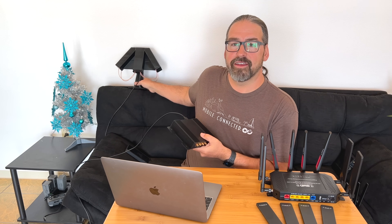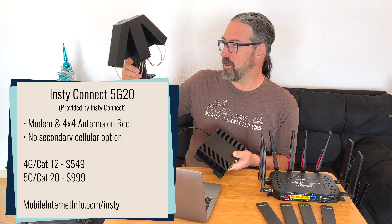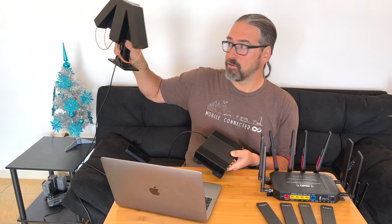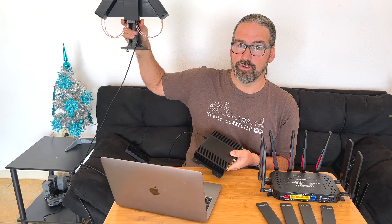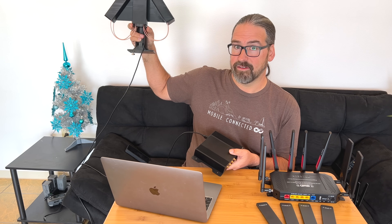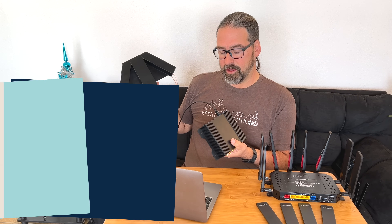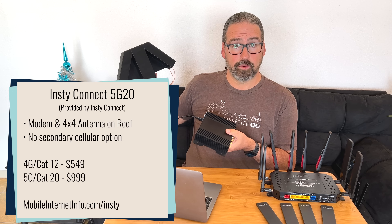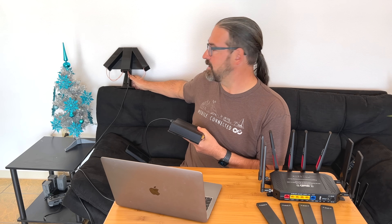On one side I've got the InstiConnect 5G, which we've also done a first look video and gone kind of deep on. The InstiConnect 5G is unique in that the modem and everything else is in a little cartridge module that mounts up on the roof of your RV — its primary market. You can put it on a pole or just mount it on the roof. So you've got 4x4 MIMO antennas and the modem connected by just a few inches of antenna cable, and the antennas are high-gain and located where the best possible signal is. The InstiConnect theoretically has an advantage by having no cable loss between the modem and the antennas, and then you're connected to an inside router via a long USB cable. Its cost is $999 for this bundle. A bit more pricey with a different set of capabilities and completely different interior features, so compare them to see which is more appealing for your particular needs.